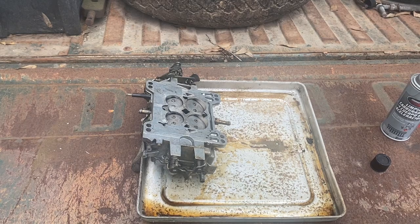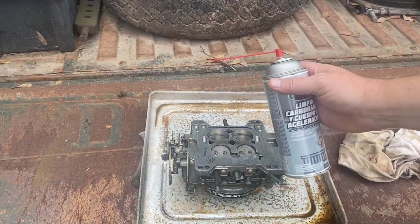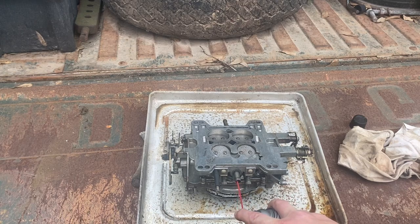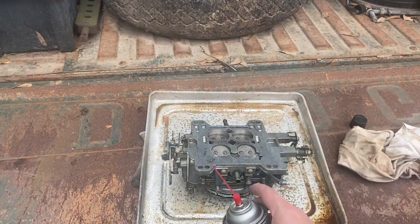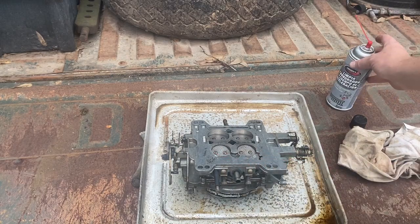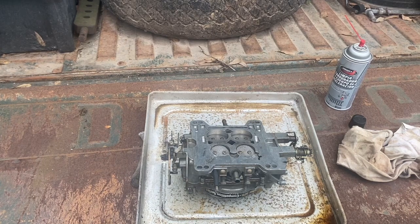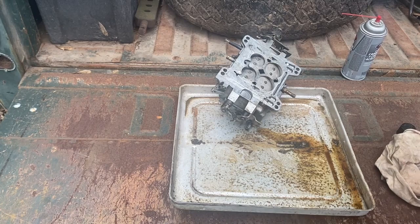One thing I do want to say: if y'all ever use the little sniffer and put it into some kind of port, either cover everything around you or stand fully away, because the force can make it splurt out of random ports. You don't want it to spray you in the eye or something — that actually happened to me a few years ago messing with an old Holley. I didn't have my safety glasses on and was staring at it too close. So just be careful where you spray this stuff, because man, it stings if it hits you in the eyeball.